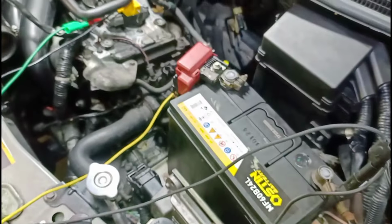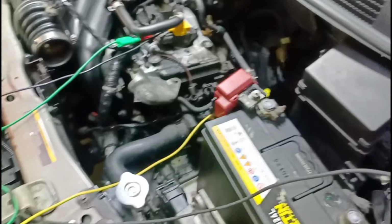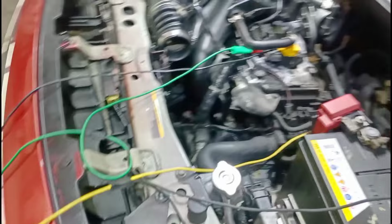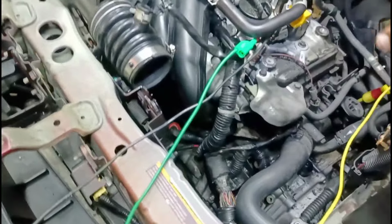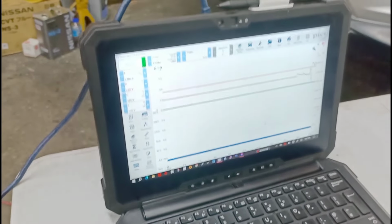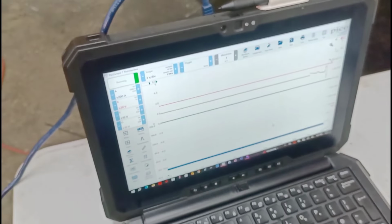I did my checks from the ECU, and I'm getting 5 volts off the brain box, I'm getting 12 volts, I'm getting power, I'm getting ground, but every so often the crankshaft sensor is not getting what it's supposed to get. So that lets us know that we have a weak signal going to the crankshaft that's causing the vehicle not to start. So, yeah, that's about it.